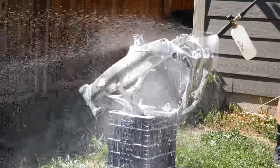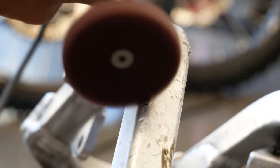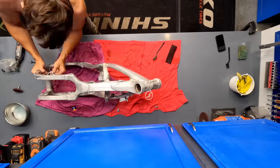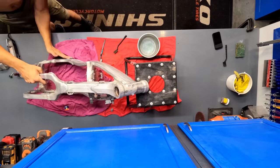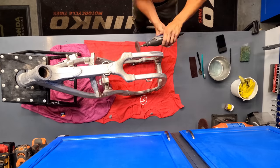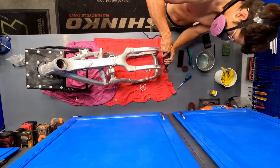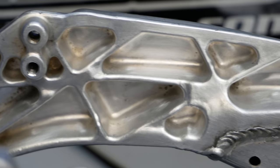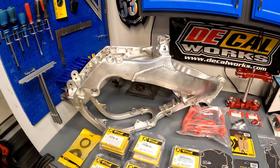In order to make Charles's life as easy as possible when he gets this frame, I'm going through and working to remove all the dirt and grease so it doesn't contaminate his cabinet, and I'm also going through with Prime MX cleaning wheels removing imperfections from years of good times. To clean and degrease this frame I used a combination of supplies. For my degreaser I used Super Clean and switched between submerging the frame in a degreaser bath — meaning my igloo cooler — and scrubbing it with a degreaser-soaked Scotch Bright pad. Between each iteration of degreasing I would spray the frame down with the power washer, first with soap and then with plain water. For the hard-to-reach places I used Dawn dish soap and a toothbrush before switching over to the Dremel. I just texted Charles to see if my work on the frame is good enough preparation for the vapor blasting, and he said it is looking good.